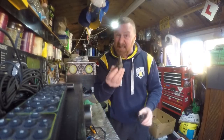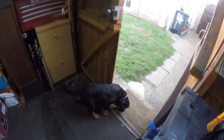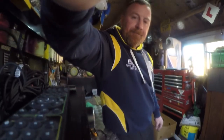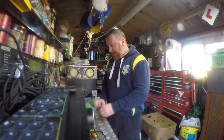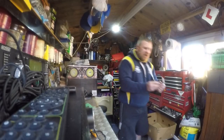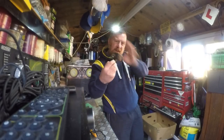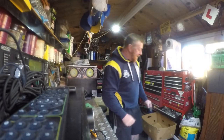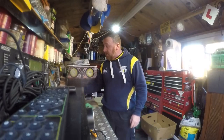They are getting harder to get - 100cc ones are nearly impossible, 50cc ones there are a couple of types. Bendix - electric start, kick start. These bits are bloody hard to get hold of. The teeth where people kick them start to rub and then you get a world of pain. If you've got a moped that kick starts but doesn't like electric starting even though you've got a good battery and it makes no sense - more often than not it is this.